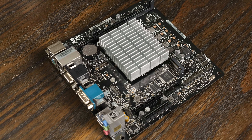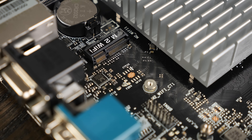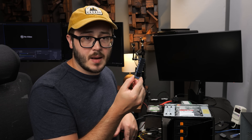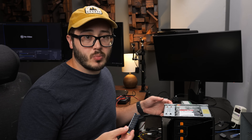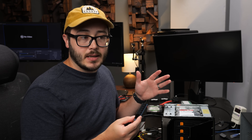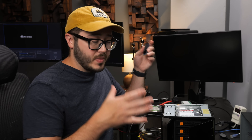Sadly, I was wrong about something. I thought I'd seen a post where someone used the ASRock N100 DC ITX's M.2e key slot with a Coral TPU or something similar, but it seems that slot only supports CNVI for Wi-Fi — which makes sense since the N100 has very few PCIe lanes and there's no reason to waste a lane on that slot, but it kind of sucks. Since everything else seems to be working, I'm going to swap out the M.2 NVMe SSD with a six-port SATA adapter to add the other two hard drives. Then I think I'm just going to boot this up with Unraid since I have USB 3 on the back, and I don't want to give up my networking by using a SATA PCIe card.